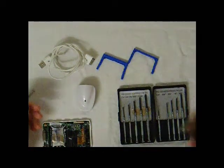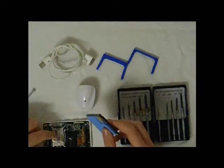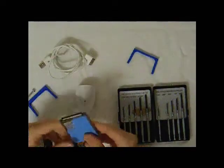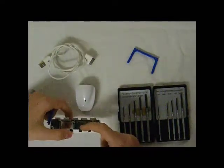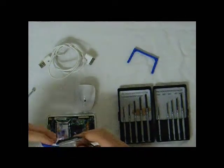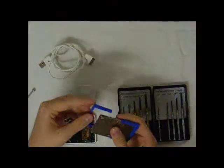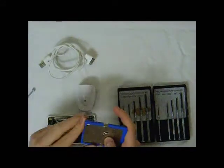I've got my new hard drive over here. This is an identical match out of a different iPod — the one that worked but had a dead battery. The batteries are getting a little harder to replace; we'll make a tutorial of that too. We're going to want to put the rubber grommets on — foam pad down. The grommets have notches on the sides that fit in with the little clips on the side of the front of the iPod. So put it so the clips are facing down and just slide them right on there. They should have enough sticky on them that you shouldn't need to re-glue them. If you do need to re-glue them, be really light about it — use the minimum amount you possibly could. I don't re-glue them because they don't need it.